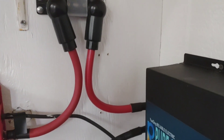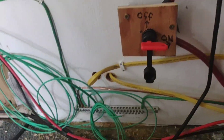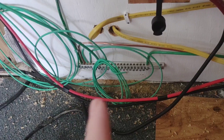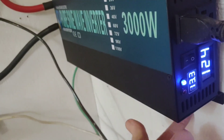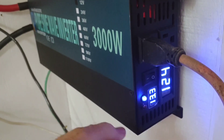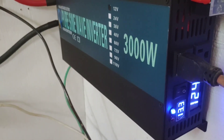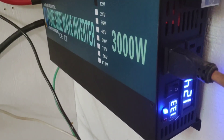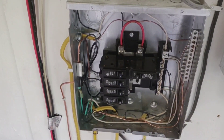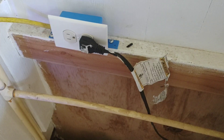Pretty happy about that. There's the close-up with the additional 200 amp fuse on this one, which complements the other 200 amp fuse right here. It's still a little bit of a debris field down here. The grounding is all coming together nicely, but the ground connection for this inverter is on the underneath side — it's got kind of a cheesy screw down there to attach the ground wire. That one could definitely be improved upon; it really needs more ability to cinch down the chassis ground on the inverter.